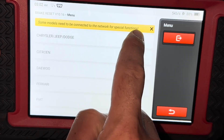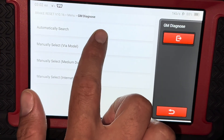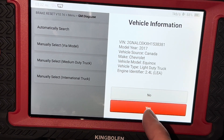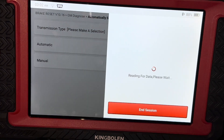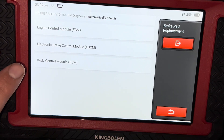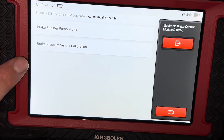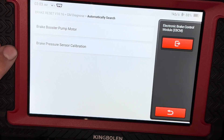My vehicle doesn't have an electronic parking brake, but I'll show you quickly where it would be. You select your vehicle manufacturer, switch on the ignition, automatically search with the VIN search, and all your information pops up — just verify it's all correct and click what your vehicle is equipped with. You'll see electronic brake control module right here — you click on that and can put it into service mode. Since mine does not have it, it does not pop up — these are the only two options available for my specific vehicle.